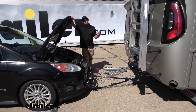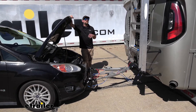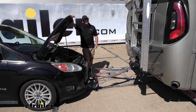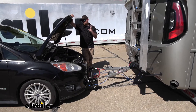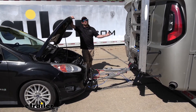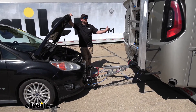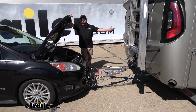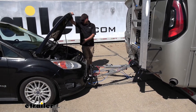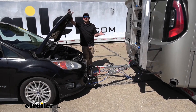I do want to address a couple of questions that people ask. One of them is: is this kit going to affect your motorhome's batteries? And the answer is no. The C-Max battery will be getting charged only when the motorhome is running, and whenever the motorhome is running its alternator is generating amperage and charging its own batteries as well. You're going to have more than enough to spare to trickle charge the C-Max battery.